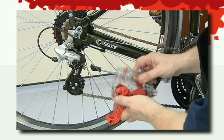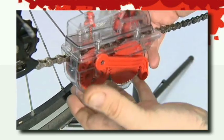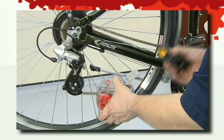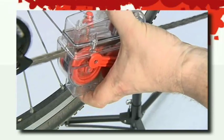In this instance, once the top and bottom casings have been located on the chain, move the arms forward until they come into contact with the front of the lower casing. Holding the machine in your hand and always keeping it in line with the chain, use your other hand to rotate the pedals and activate the cleaning mechanism.